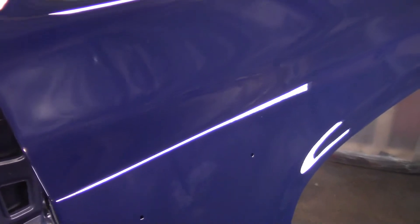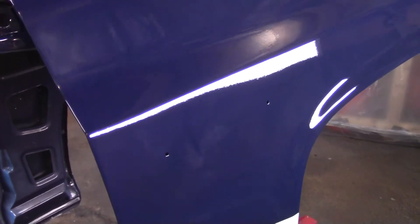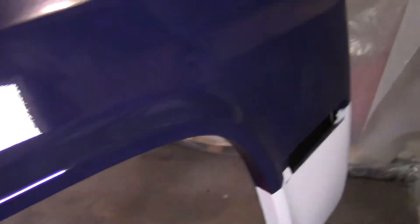I put two really, really wet coats of clear on here, and it was actually so wet that I was afraid it was just going to sag. I don't know if y'all can tell, but I got a little orange peel. I'm hoping I got enough up here. I hit around and then came back and hit this back side right here. I went ahead and took all the masking tape off when I cleared — I didn't really care if I got a little overspray on the back side with the clear. I do see a few little specks here and there, and that's to be expected. I do have some runs in it — I seen it running on the first coat right in here. I don't have much room; I could have moved this a little bit, but I've got some pretty good runs right there.